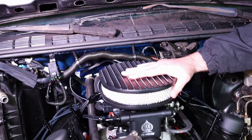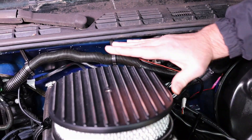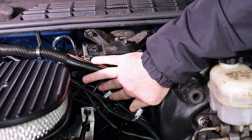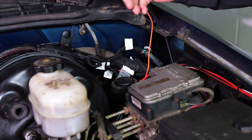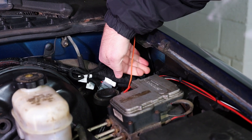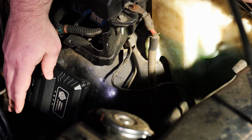When you're laying these things out — I know we're not quite done with this video yet — I just wanted to walk you around the engine bay just once. So if you imagine starting at the throttle body right here, we've got the PIC connector on the side over there, and it travels on back, picks up the VR connector, the coolant temp sensor over here, and then continues on over. You see there's a little CAN cable right here — I haven't hooked that up yet, it's a whole different thing later. You've got a little VR back here doing its job, and then the wiring harness just continues on. I've got a couple things folded back and zip-tied, and we get over here where the coil connector is, which we're not using because we have a high roller. We've got the additional wires tucked in and run down the fender over here to the fan hookup. So the main harness continues on and hits the ECU down here.